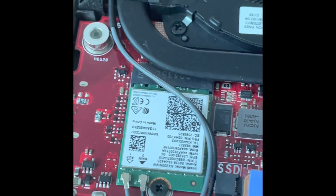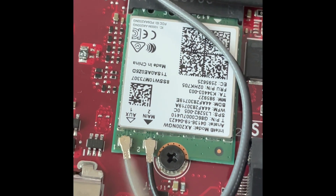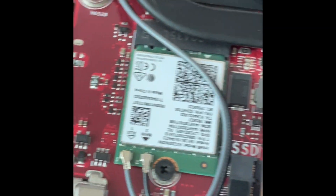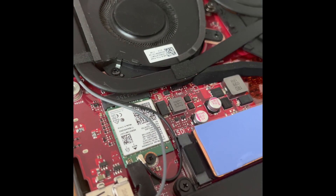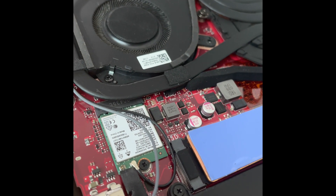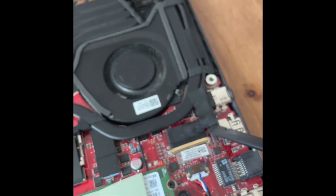The tools you need are not much — just a plastic pry tool and some basic screwdrivers. You can buy a set of these. I also have a bunch of wipes we'll be using later. Now that I took off the tape, I'm going to remove both antennas. Take your time, everything slowly — you don't want to mess up anything. I just put the little plastic tool under and lift it, and that's it. The antenna is disconnected, the screen is disconnected, and the battery is disconnected.